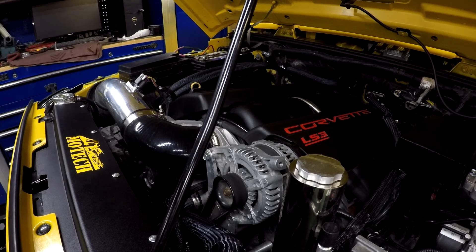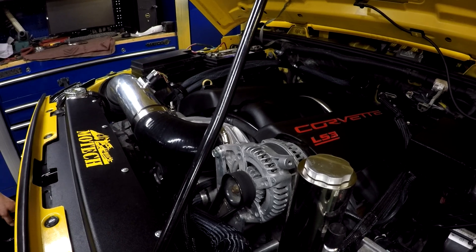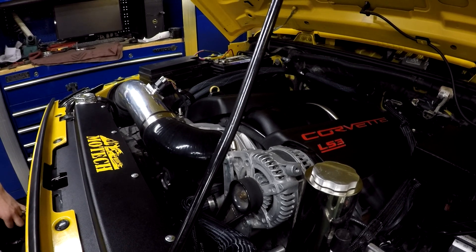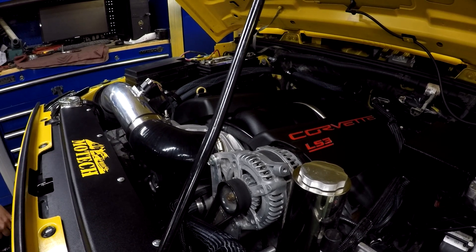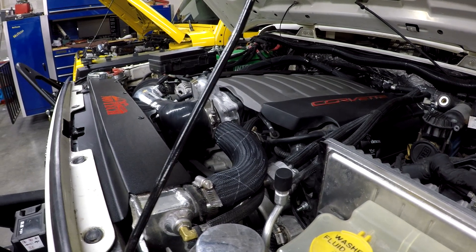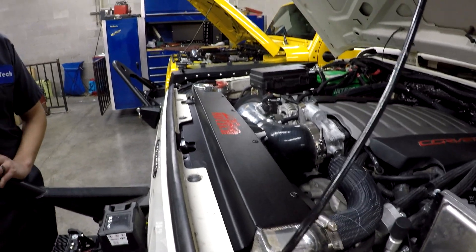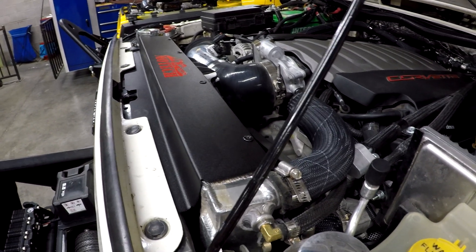We need that extra pressure for direct injection, and there's a lot of technology that goes along with it that these Gen 4 engines don't have. But sequential fuel injection is a huge leap ahead of carburetors, throttle body injection, and even port fuel injection — so it's still no slouch. The LT has one step up on fuel injection and one step up on variable valve timing: instead of VVT, it's CVVT. On that vehicle we're running all the Jeep accessories; on this LT vehicle we're running the GM accessories — alternator and air compressor in stock locations.